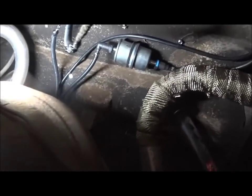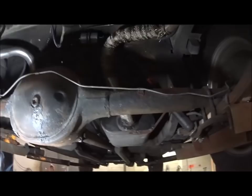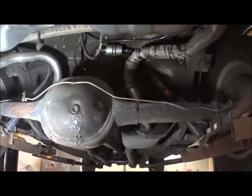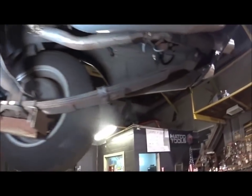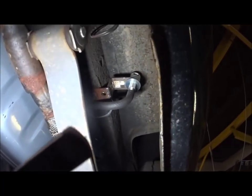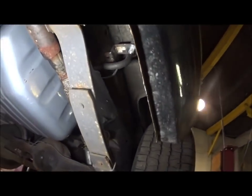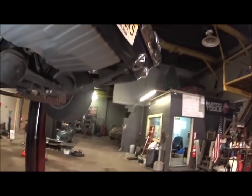The fuel filter is secured in a bracket — basically a factory-type install. The clamp has rubber so it can move a little bit. Quick connects again, so you can easily replace the filter. It's a factory-style filter, not a race filter — you can buy this at any parts store. I gave him the part number. The only other thing is this rollover valve and vent tube combination that we had to install. Had to make a bracket for it since they didn't include one.